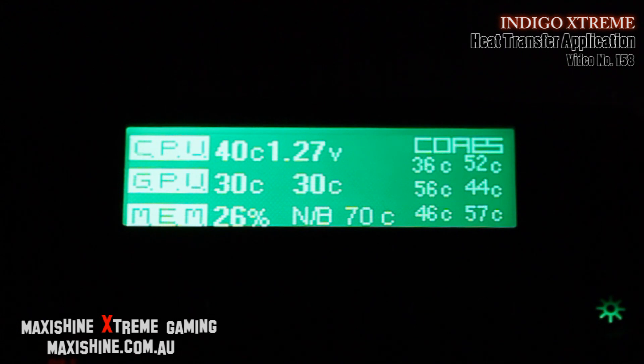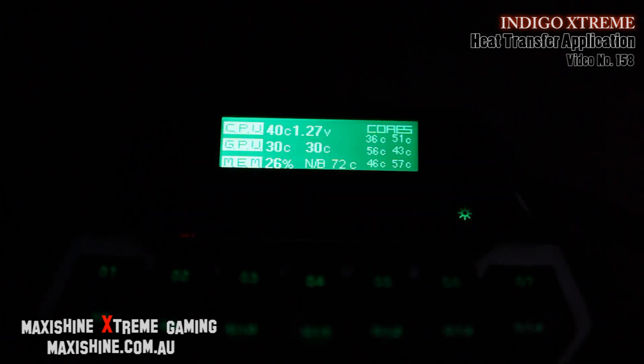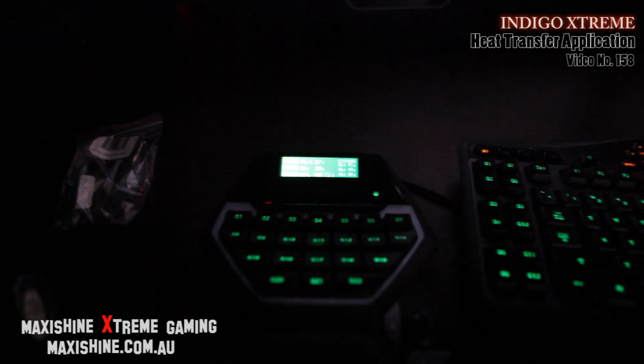One core at 35, one at 57 — I'm not sure about the variation. I've been asking a lot on the forum and no one's gotten back to me about what each core should be running at. But still, not hitting over 57 degrees, which is awesome for a 4 GHz overclock. I'm going to go ahead later on and push it a bit more in the next video. Very happy with this stuff — some of the best results I've ever got.